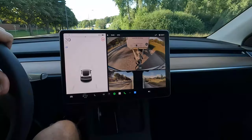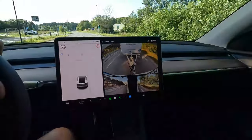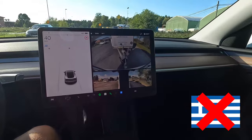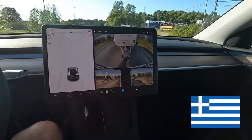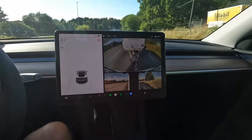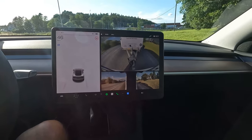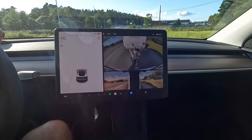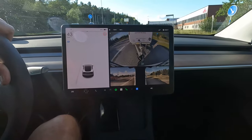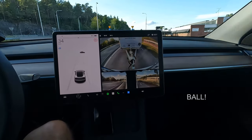It's very important to double-check the brake lights and signal lights of the trailer. I also noticed there was almost no grease on the trailer hitch ball — without grease it will make a lot of noise, and that's not good. You need to grease the trailer hitch ball. Just put on some regular car grease and it will be perfectly fine. Remember to do that now and then — it also helps avoid rust on the ball.